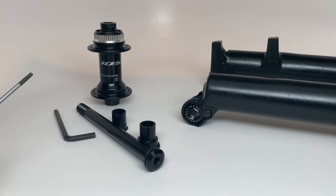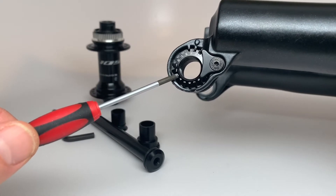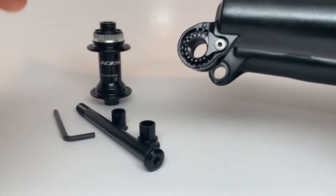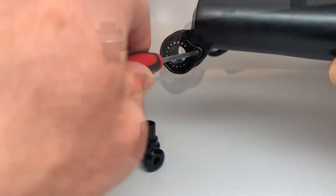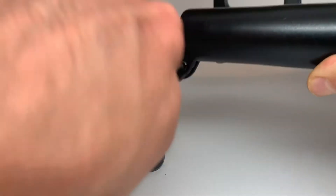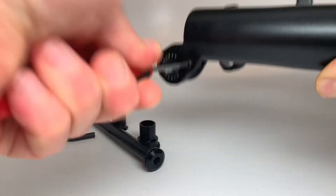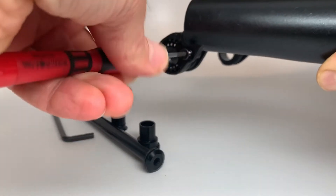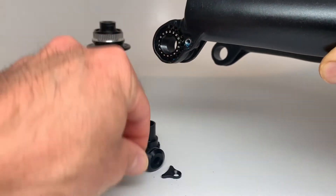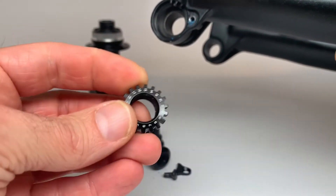This kit's pretty straightforward. I have here a set of Fox lowers with the original M14 threaded insert. I've got a 2.5mm screwdriver here. I'm going to remove this small screw here on the non-disc side. It's got a little bit of thread locker on it, so that's going to take some effort. Once you've got that backed all the way out, set that in a small plate aside and pop out your insert.